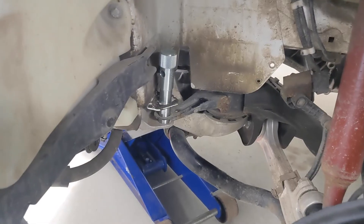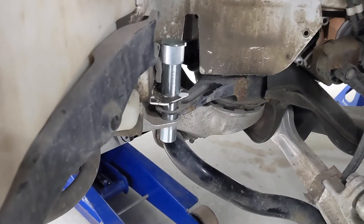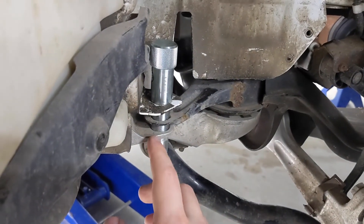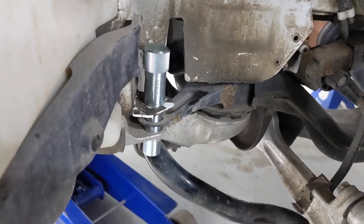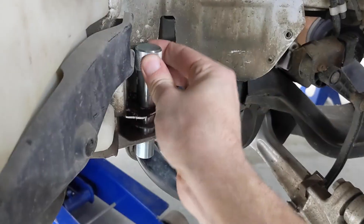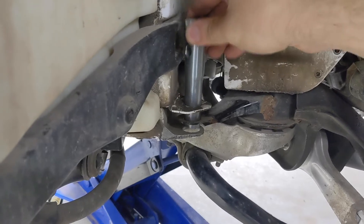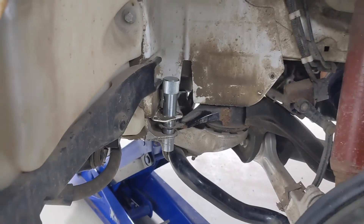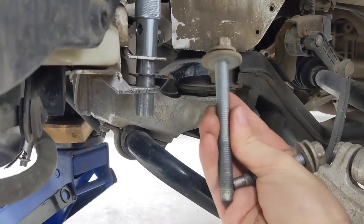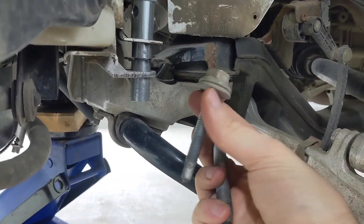I'll apply some pressure since the fresh hardware is in but not tightened down, and wait until the tool drops into place. It didn't take long for the tool to fall into place, but it's still held in here with pressure, which tells me the motor mount bracket and subframe are still a little far forward. So I'm going to get my negotiator out and move those items back towards the rear of the car so I can freely move the peg. After quite a bit of fiddling, I got the testing tool to fit loosely — and the passenger side still fits great. The big bolt in the back torques to 81 foot-pounds plus a quarter turn, and the two smaller ones in the front are 55 foot-pounds plus a quarter turn.